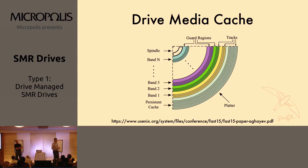Drives have always had some amount of cache and RAM on the drive themselves, which they can use to buffer writes, cache reads, and smooth out performance. The media cache behaves very similarly, but it's actually persisted — it's durable and written down onto the platter. It's much, much larger than the RAM cache. The RAM cache might be around 128 megabytes, but we have tested and found that the media cache will start impacting performance and fill up at around 30 gigabytes.